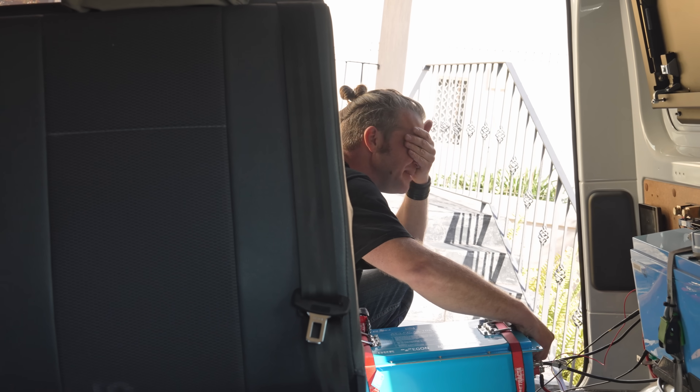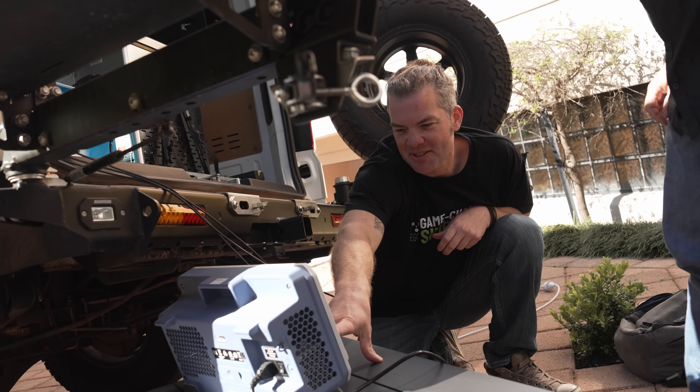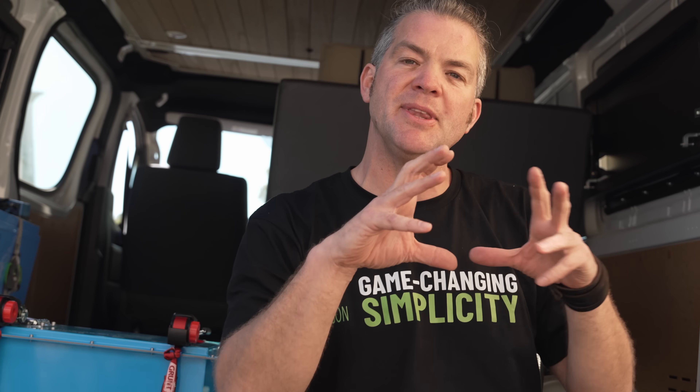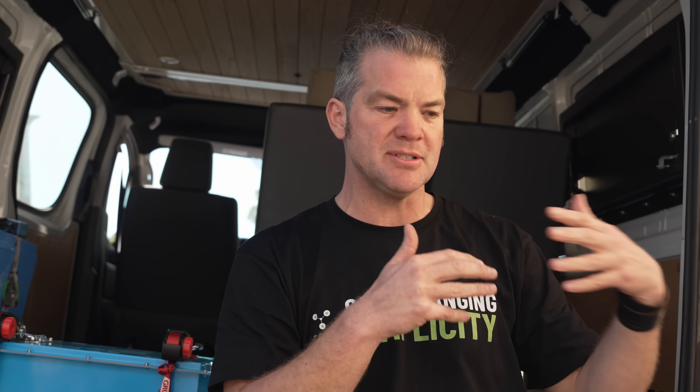Okay, 4 kilowatts — I'm going to disconnect the battery. Cool, switch it off. You can see exactly the transistors turning on. You heard the engine rev go up — that's when the load got taken away from the alternator. But we had 4 kilowatts of energy flowing, and that energy flow doesn't stop immediately. It takes about 200–300 milliseconds before the alternator shuts down. In those 200–300 milliseconds, 4 kilowatts of energy have to go somewhere. If you don't give them anywhere to go, you get massive voltage spikes — up to 300 or 400 volts.